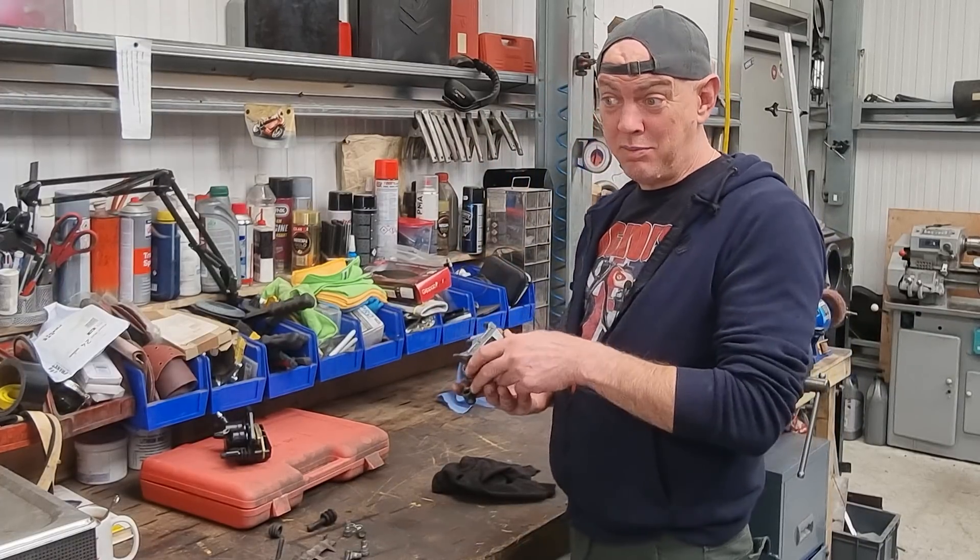I'm having no luck today, no luck at all. This is the rear brake master cylinder and it is jammed in there. That other service kit I've got is for a front brake master cylinder so that's no good. The whole piston assembly is absolutely jammed in there - I can't get it out at all. I'll try compressed air down the end - I've had WD-40 and everything down either end, I've had a grease gun on it trying to force it out. It's not having it, it's properly jammed in there. It's not going to be expensive - probably 30 quid to get another one.